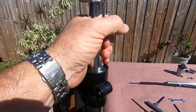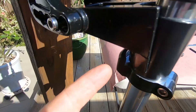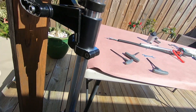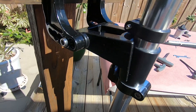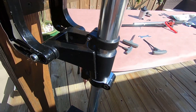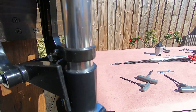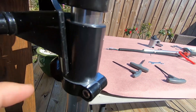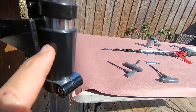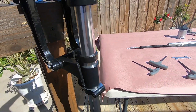The clamp will be going back up for the tiller in a moment. Note that now it's spun around, the locking mechanism will hit the back end of the lower bracket, preventing it from moving up. These are pretty robust — if you strike something you can repaint it; I've never had one crack. I leave a little gap so it doesn't touch the bracket, and I grease it here as it rolls around. You have a pivot point here as well as here.